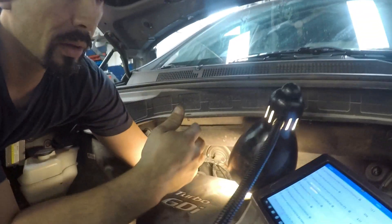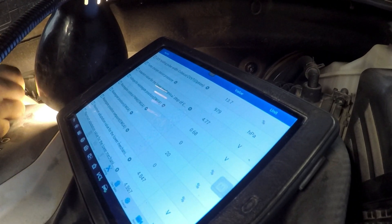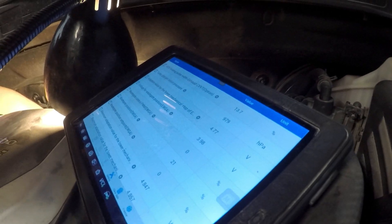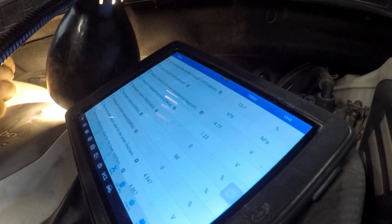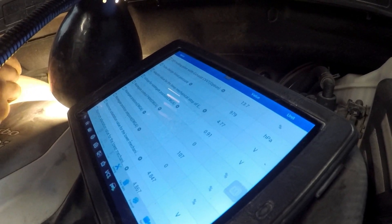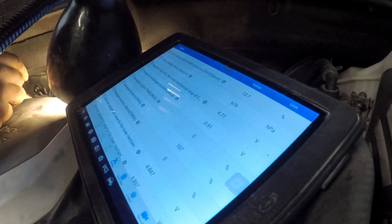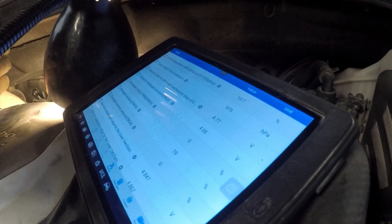Okay, so adjusted — wastegate open, wastegate slammed shut, electric motor — that should be 4. 3.98 is within tolerance. So it opens again, boosting, flying down the street, passing the stupid transport truck. And then 3, 2, 1, you let off the boost. 4.06 — we're still within spec.